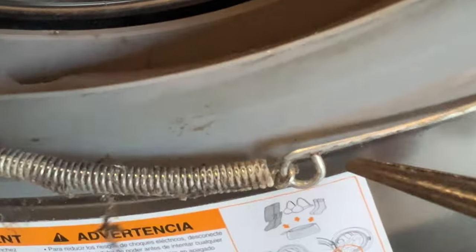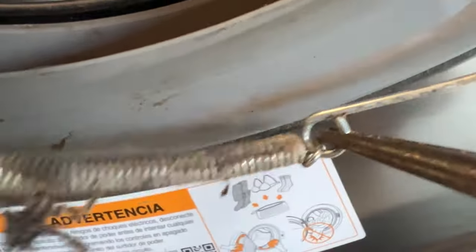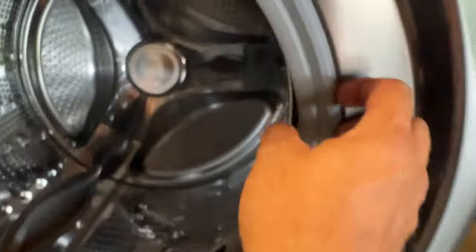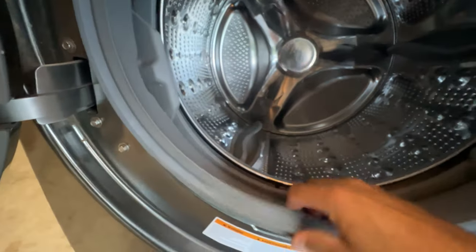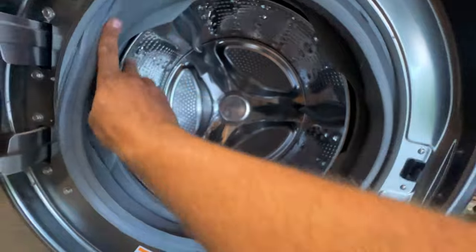I just took a pair of pliers here. There's this spring down here and I just pulled it with the tip, and it came right out so quickly that I couldn't even show you. Then this thing just peels right around, and you just want to tuck this in because we're pulling the front off so that we can get to the water pump.